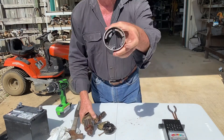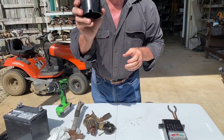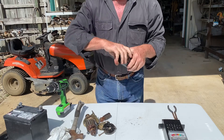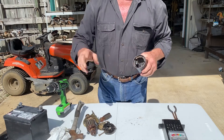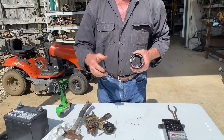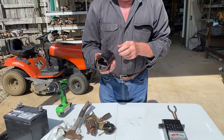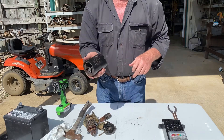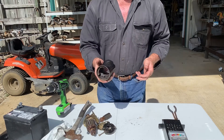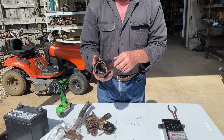Look on the inside of that — that's the results of when you hit it with a hammer. A lot of people come in here and I grab the Bendix gear and go to turn it, and it won't turn over. I say, 'What's wrong with it?' 'It won't start.' 'Well, did you hit it with a hammer?' 'No sir, I hadn't hit it with a hammer.' Well, I look right here and there's all kinds of little peck marks on the side of it. 'Well, who done this?' 'My brother-in-law done it.' Y'all got a good brother-in-law — he would never do nothing like this, but he gets blamed for a lot of it.